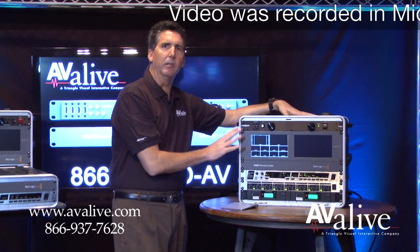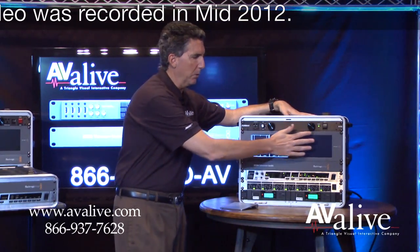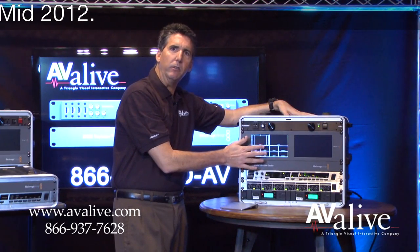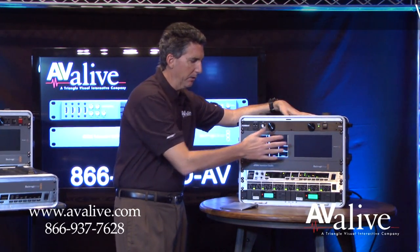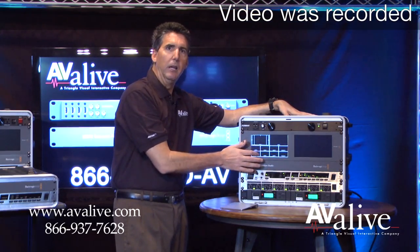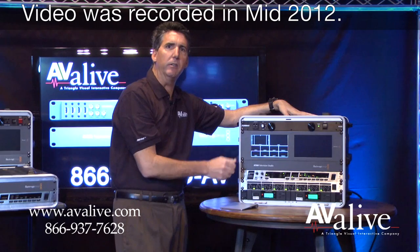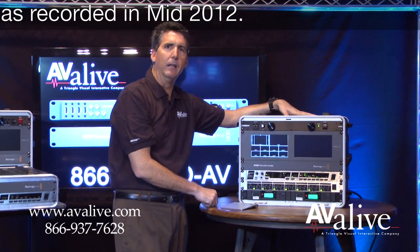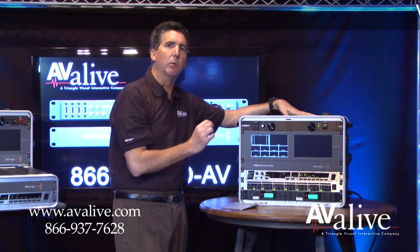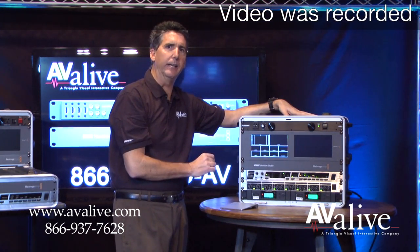The purpose of a unit like this is perfect for out in the field because it gives you your preview monitor as well as your output monitor and allows you to easily record to disk — your program output — as well as use your cueing for your multi-view. It's very important to know that the ATEM TV Studio, while it records to disk in H.264 format, it cannot do H.264 and live web encoding on the same unit. You will need to break that out as a separate entity, and we'll take a look at that a little later.